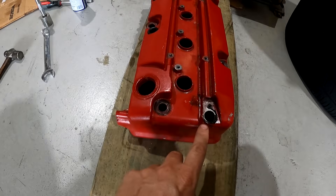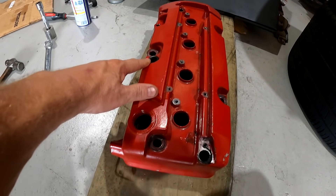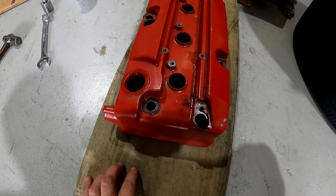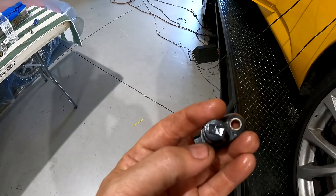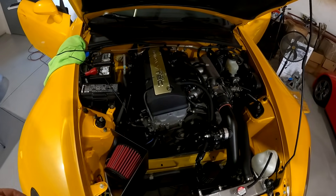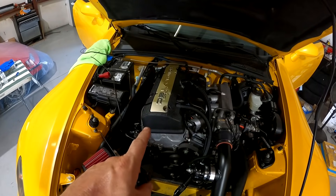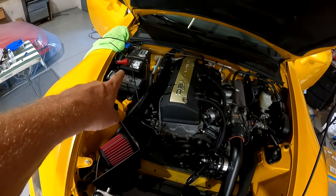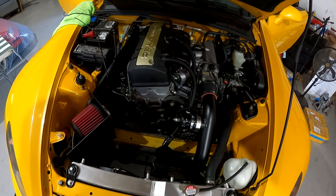This is a 2006 that should have a single sensor - you can see in the shadow right here it doesn't have the sensor on this side. The valve cover that came off is actually a 2000/2001 S2000 piece - you can see by the rubber grommet where the PCV valve would go. Somebody had machined it down and ground the surface height to try to make it work on a 2006 car, and in doing so damaged the sensor - it was rubbing the gear. We replaced both the valve cover and the sensor, so now it's the correct 2006 single-sensor cover, wrinkle black, with the brand new spark plug cover. It looks really nice now, and we also did the VTEC solenoid, battery tie, and master cylinder brace.